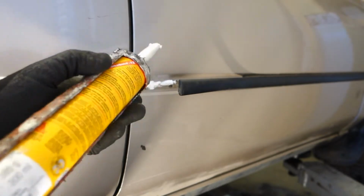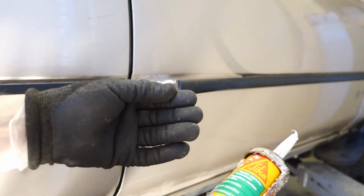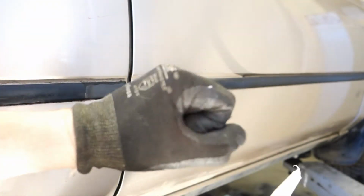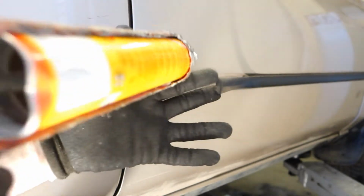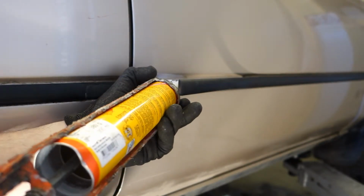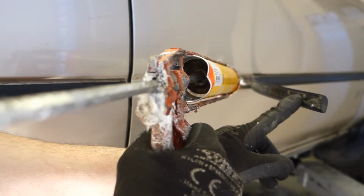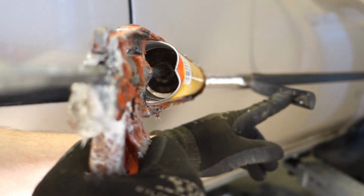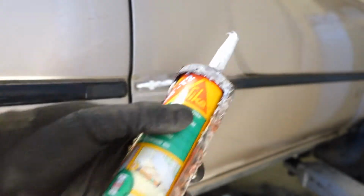And then remember, this Sika is really harmful to our skin. If this goes to my skin, like in that area, it is very difficult to take away. So always use gloves, because this Sika grip is so hard. And this elasticity lasts something like 10 to 20 years. And please say if you could find a better product than Sika, I would be very happy, because I have used that product like 30 years, and this quality has been always excellent.